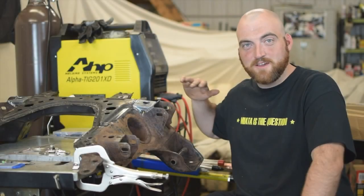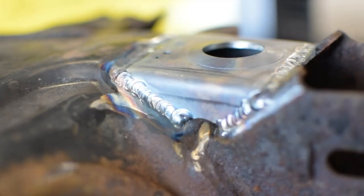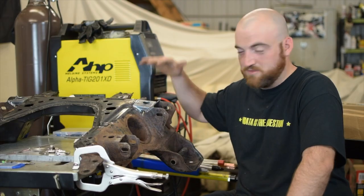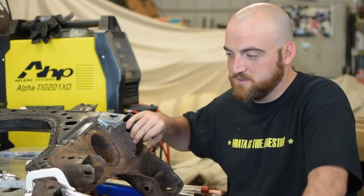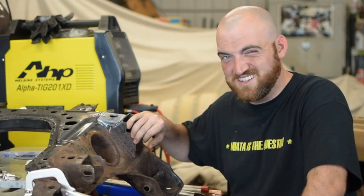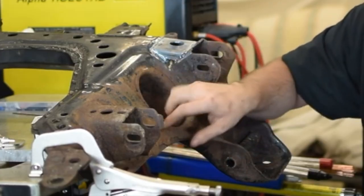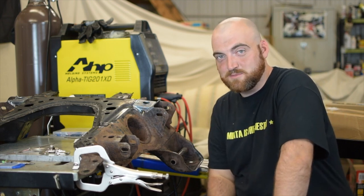So that's it — definitely would have been faster with a MIG. I don't have a MIG, so it looks better, just takes a lot longer. There's no way these are going to break now. If these break, something else is very broken and the car is probably out of commission. The next step is it's going to get sandblasted and maybe powder coated. I'm not expecting a perfect finish — this is very pitted. Worst case we'll just POR15 it and slap it all back together.